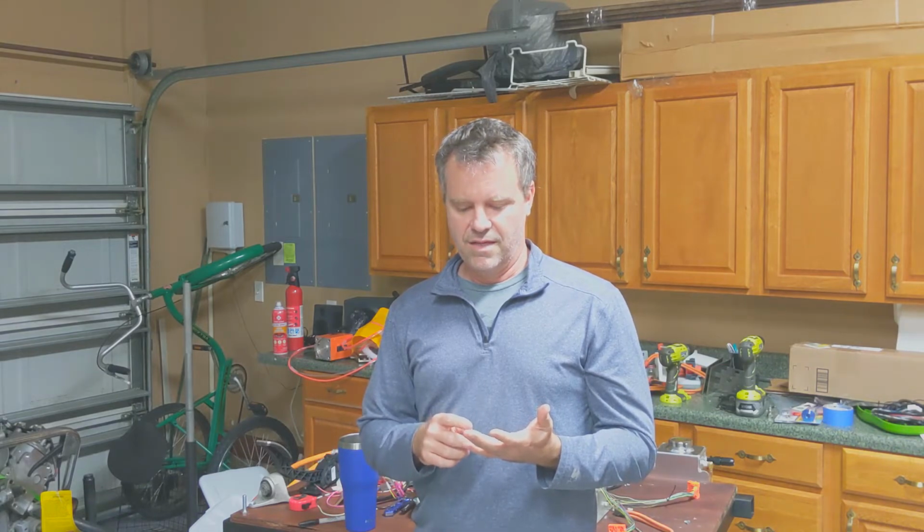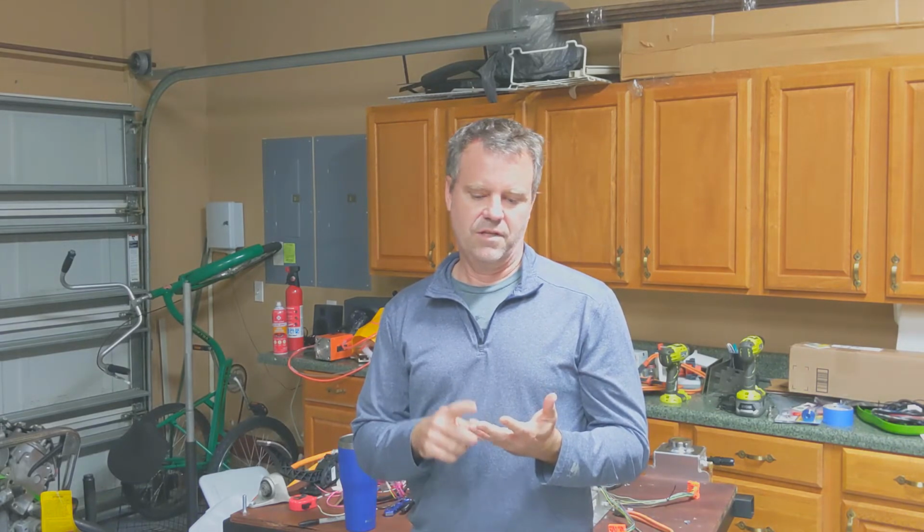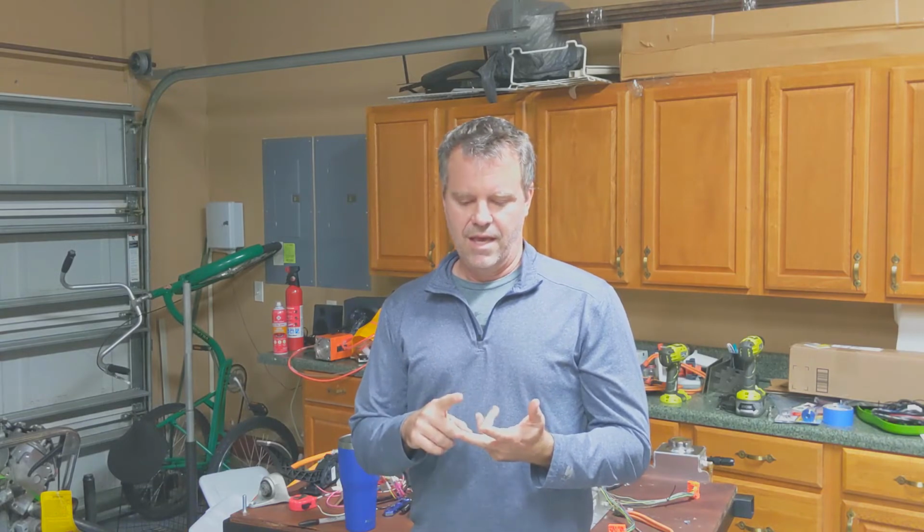And finally, what we're going to do in the next video, which hopefully won't be 30 minutes long, is we'll deal with the other part of the wiring. So we got the cell taps in place, but the next thing to do is to hook up the BMS to the charger and to the inverter and to a 12-volt power source and a couple other things so that it can do its real job besides managing the batteries, and that is also controlling the rest of the drivetrain, telling it when it can operate and when it should shut itself down because there's a problem. So we'll cover that next time.